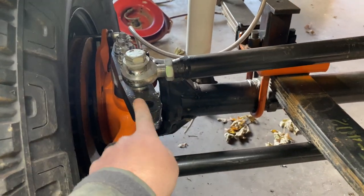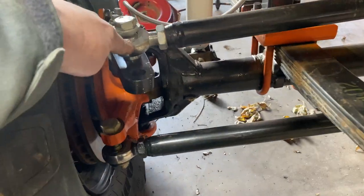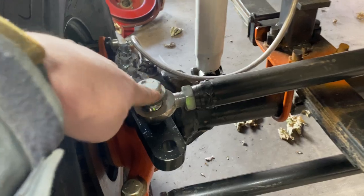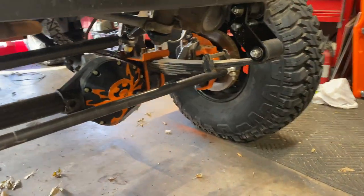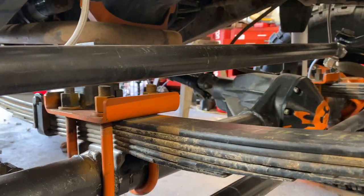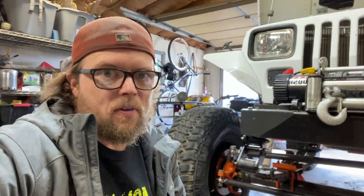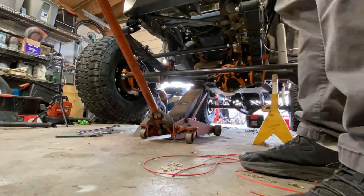So what we're gonna do is drop this tire off and see how far this knuckle will turn when I jack it up. We're gonna try it in this hole and then this hole, and if it goes far enough, I'm gonna move the tie rod up here, get both links up above there, and hopefully this thing will turn and handle better. Then I get to figure out how to put my hydro assist way up there. I want to get this thing steering right first so the ram isn't forcing things where they don't need to be.